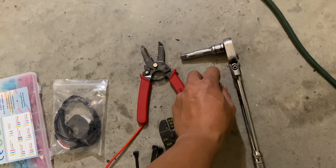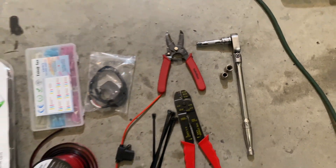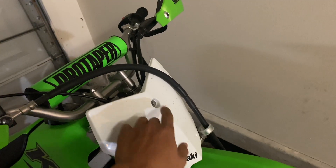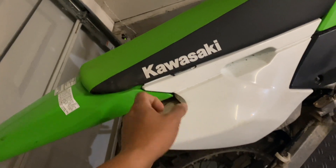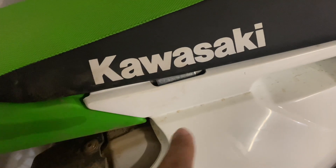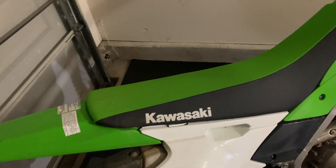Just some basic tools to remove the plastic panels and access the wiring and battery — in this case for the KLX, just an 8-millimeter and 10-millimeter. First step is to remove the plastic panels and the seat so we can access the battery and properly route the wiring to the front. To remove the front number plate it's just an 8-millimeter bolt, then you pop it upward and pull it right off. The side panels are secured by 8-millimeter bolts and a clip — pull the panel outward, slide it back, and it pops right off, giving you access to the two 10-millimeter bolts that hold the seat in place.